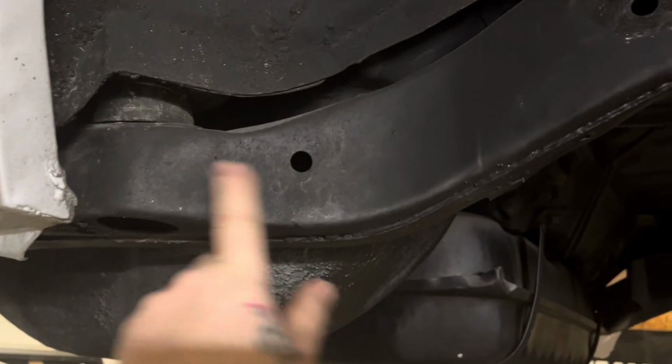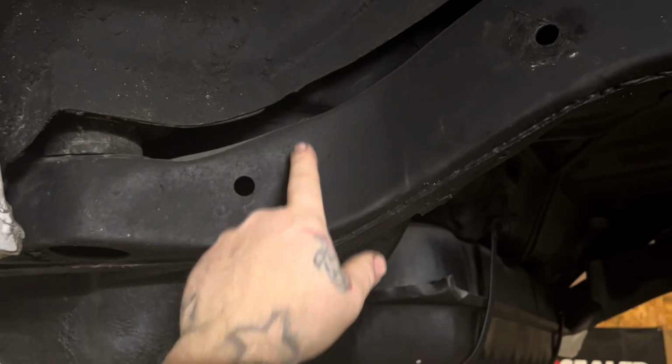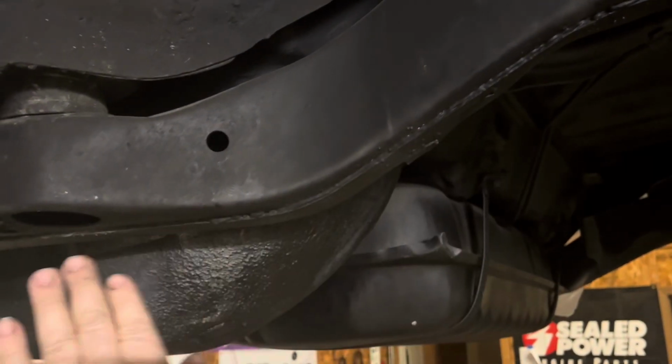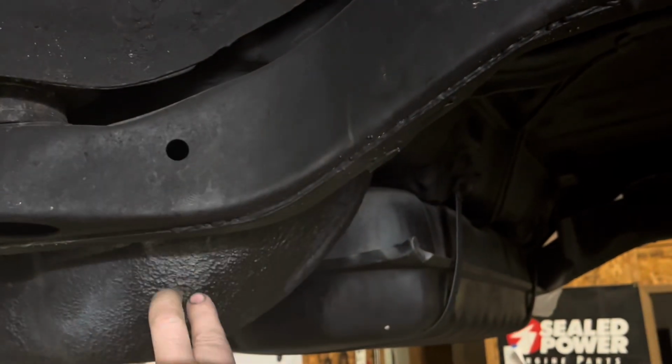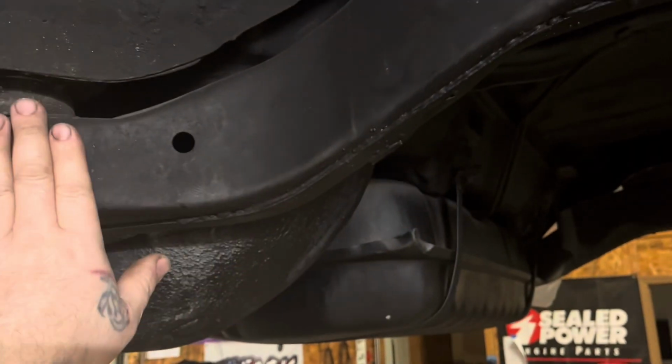I'm working with a very clean car. Boom. So I'm gonna be doing the quarter rail notch right here, which I have the videos of, and I have it on IG, how I slid it, roll it in, trim off the bottom, trim off the top, plate it, and weld it all up and then file it.